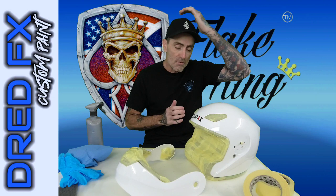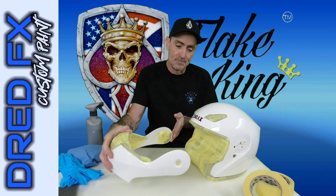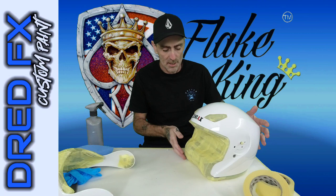There you go, in that first time lapse you see me mask off this lid, and I'll just give you a little talk through on how I did this. I had to take the front flip visor part out, and there's two locating bolts either side on this front piece. You undo them and then that piece with the visor clips away. So that's how I got that piece off, and then I started to mask out.